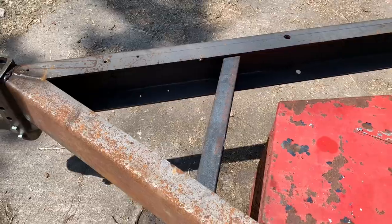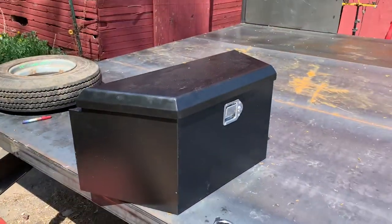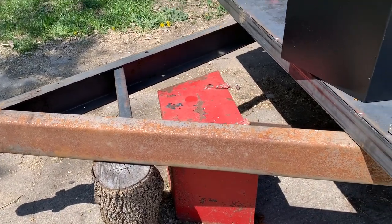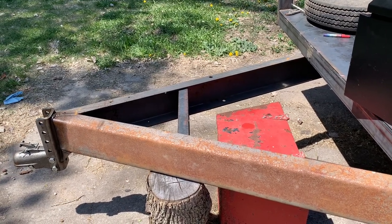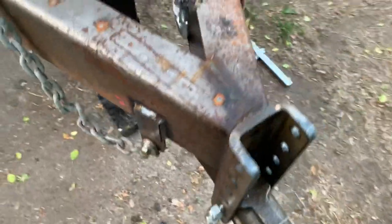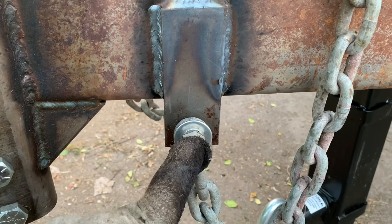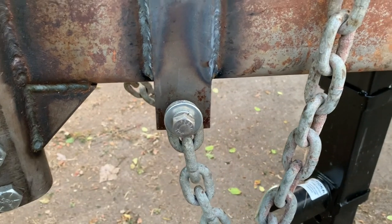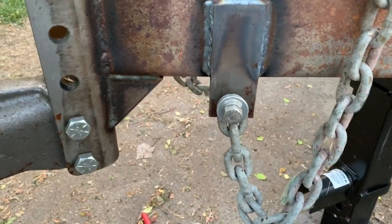I didn't know where to put the jack, so I finally just went about where it was. I'm going to cut the angle iron off, get it mounted, put this toolbox as far forward as I can. And if I hate it, I'll just put something else on there later and probably weld that hole shut. Here you can see what I did for my safety chains - nothing special, just a scrap piece of half by two with a half inch hole drilled in it and the chain bolted on in case you ever need to replace it. I noticed one is a grade eight bolt and the other is stainless steel - years down the road I'll let you know which works out better.